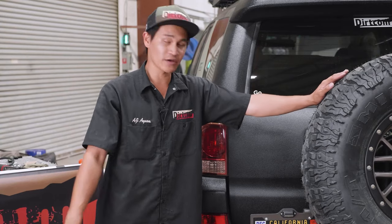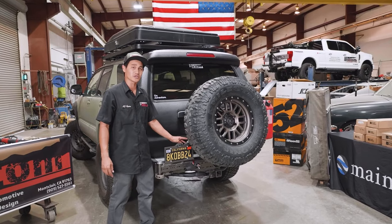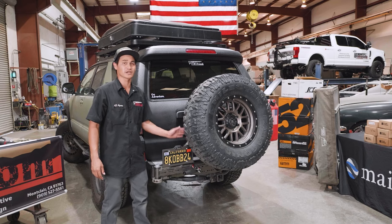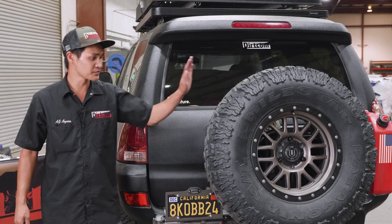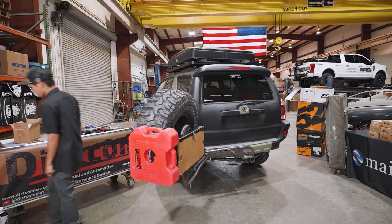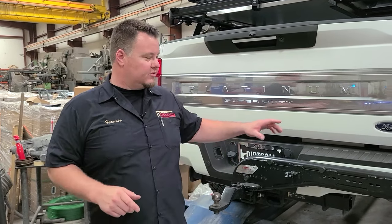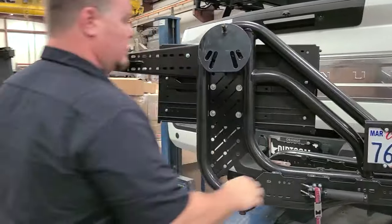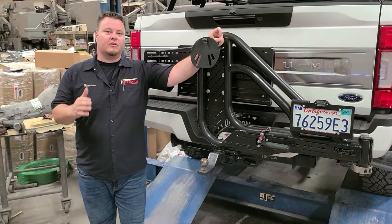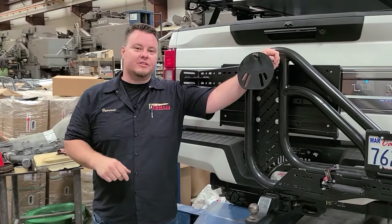Hey guys, really appreciate you watching and checking out the install of this trail swing. Just remember that chromoly tubing is used in race cars for a reason — we chose 1.5-inch chromoly tubing because it's strong enough to be compact and lightweight for small vehicles and CUVs, but still strong enough for 4Runners, Tacomas, and other midsize SUVs with 35-inch tires. If you're a full-size truck owner, check out the trail swing HD — it shares the same characteristics and features as the trail swing, just made larger and stronger for your full-size truck. Whether you own a midsize or full-size truck, the trail swing is made for your vehicle. Come check us out at DirtComUSA.com or on Instagram and Facebook at Dirt Complex. Thanks for watching — be safe on the trails, see you out there.